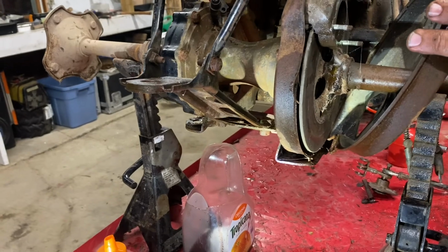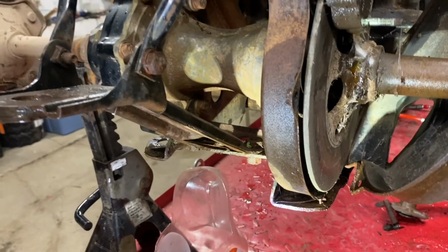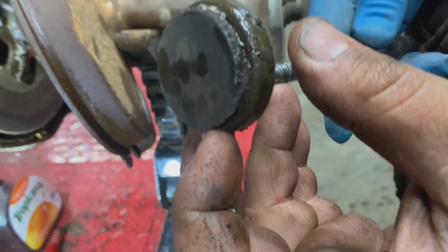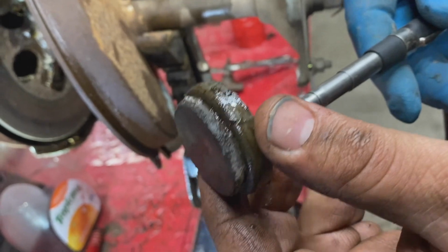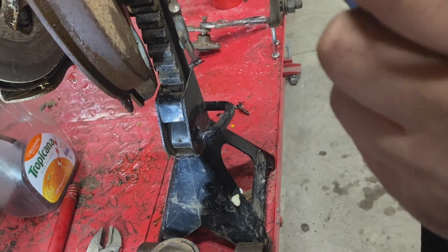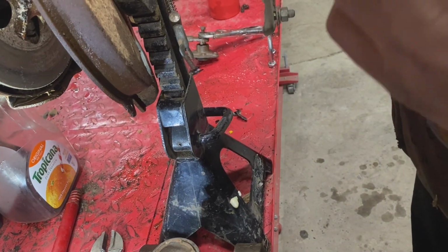As you guys saw on the time lapse we just shot, we inspected the rear brakes, and it looks like there's some meat left on the pad. She's got a healthy amount of meat on her. That's plenty fine. I don't see no cracks. A little bit of glazing, but that's not terrible. No, that'll wear off.